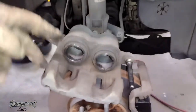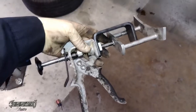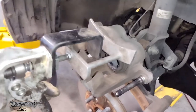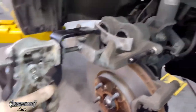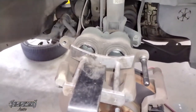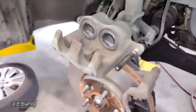I'm going to have to compress this piston. This caliper has two pistons — they both need to be pushed in at the same time. If you push one only, the other one's going to pop out, so don't do that. I recommend this tool — it's called a dual piston caliper piston tool, and it will push both of them in at the same time. This tool can also be used for any other brake caliper, like a single one, for about 99% of calipers. For big trucks with four pistons you'd need a different type, but for this, it's the way to go.